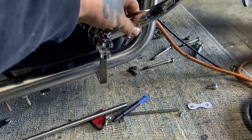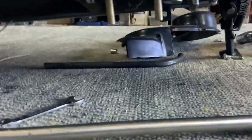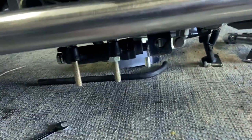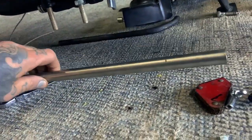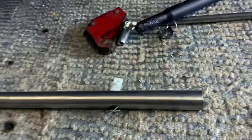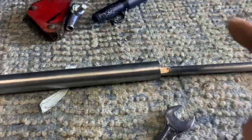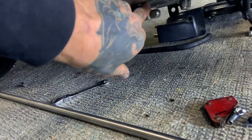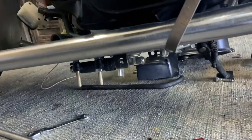I've got this where I need it now and I've got my little bit of flat bar as my mock-up. I've welded my bolts on that are holding onto my rear brake master cylinder for the rear brakes. I'm now going to put a piece of tube on the frame and it's going to be welded up underneath. Then I'll have a rod which will go through the tube at the same size and move back and forth through it. This tube supports my rod from swinging and stops the master cylinder from moving. So I'm going to make all the rod and get that working correctly.